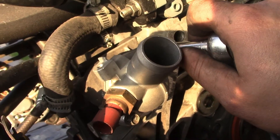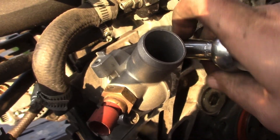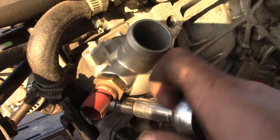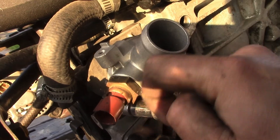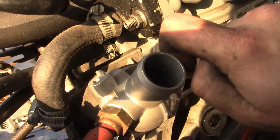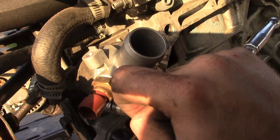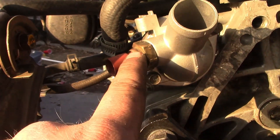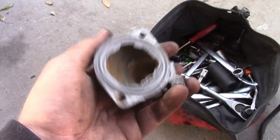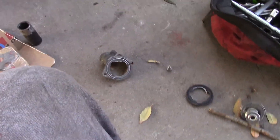This is how I tighten up things - increments after increments, so that way everything sits flush and easy, nice and squeezy lemon peasy. And then I tighten it like that. There it is - your thermostat housing is now done. Changing that is easy, just change it out, put it back in, and your 10 goes here. All done. No more crusty silicone thermostat housing.